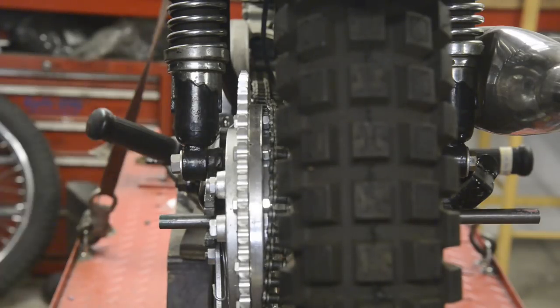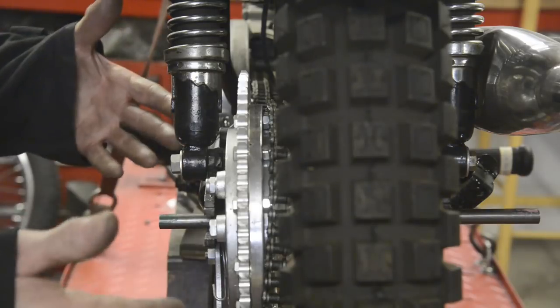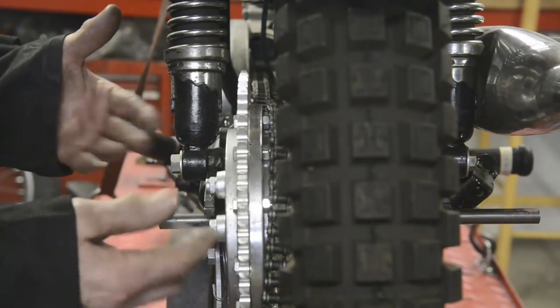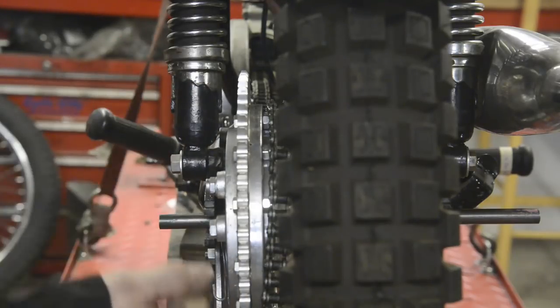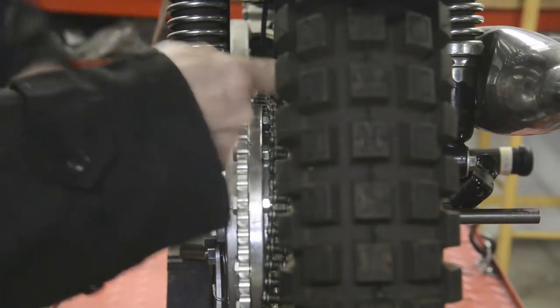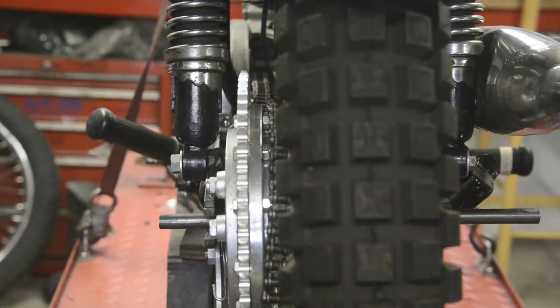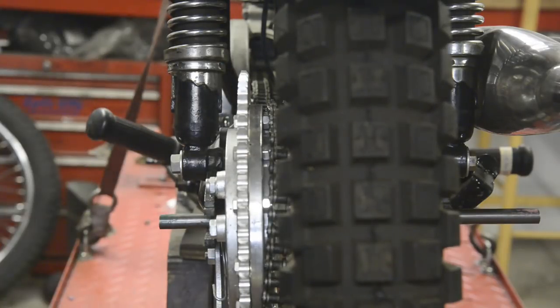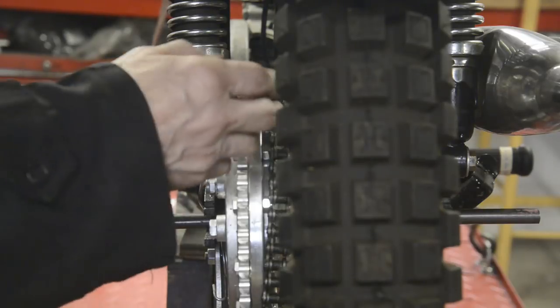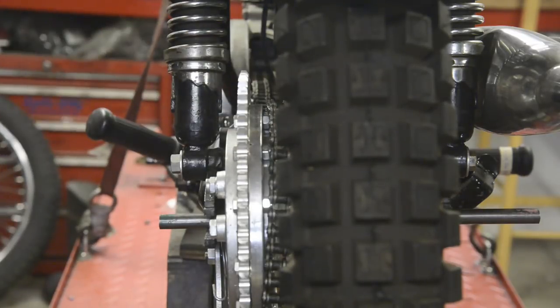because of the shape of the hub, and that's what it is, you see. Although it's the same size as the BSA one, the BSA one immediately starts to thin out, to slope away from the swinging arm, both sides. And on this side, it has the speedo drive, so the hub itself is further in. So although this will fit in between the two arms, it won't really fit into the swinging arm itself. So, another chapter built, see what he wants to do.